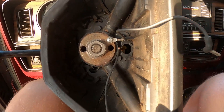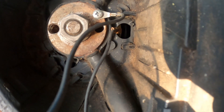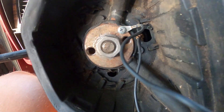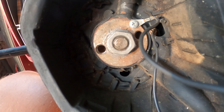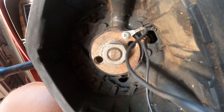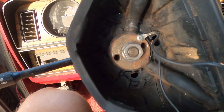What you can do is turn the steering wheel - you see these holes right here, one here, one here - turn these and work the blinker. Now I don't know if you're going to be able to see this, but yep, you can see it moving there. That is the contact for the blinker right there. Turn the left blinker on and it's on its contact pad right there, so I can see the contact making contact with that metal pad.